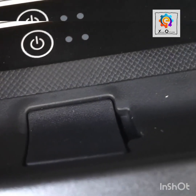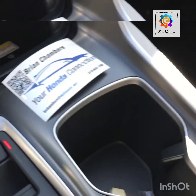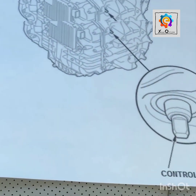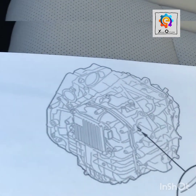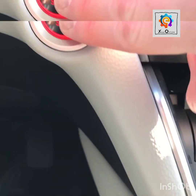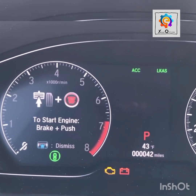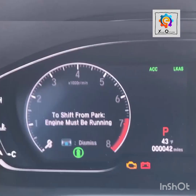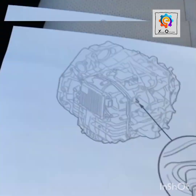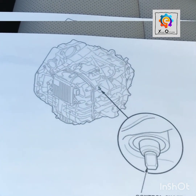So what happens if you need to put the transmission into neutral but can't get the engine running with one of these push-button shift models? You actually have to pop the hood — there's a control shaft on the transmission that you physically need to turn to put the transmission into neutral without the vehicle running. Let me show you what happens. Shut the vehicle off, hit the button twice, then attempt to shift into drive: it says 'to shift from park the engine has to be running.' So if the engine won't run but you need to get into neutral — to pull it onto a flatbed or hook up jumper cables — you'll need to use that control shaft.